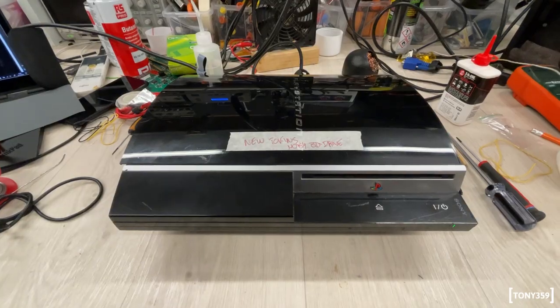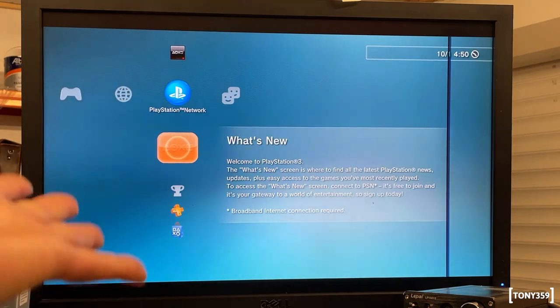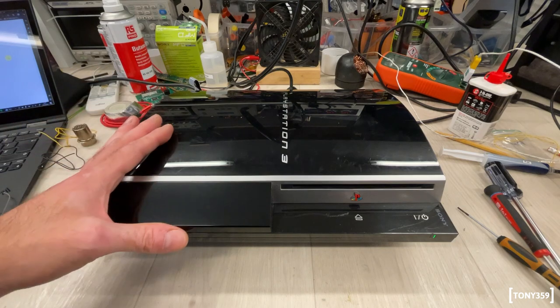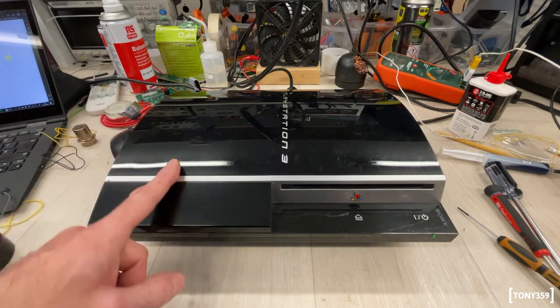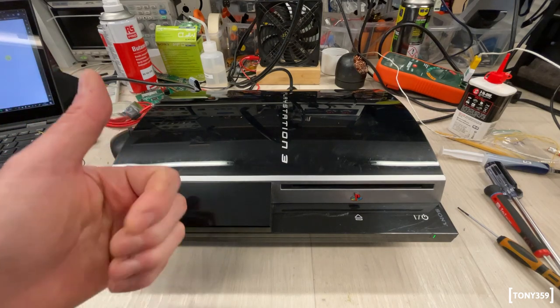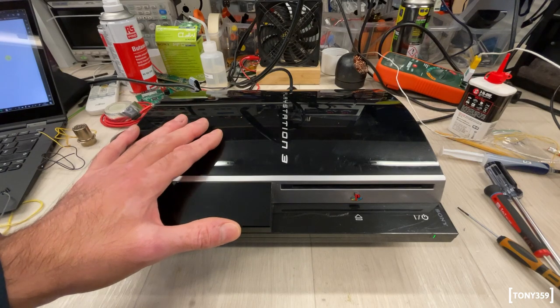Is it doing something? Yes — yes! This is working! Fantastic. This is my first successful deliding of both GPU and CPU. It's working. I'll take it inside and play some games. I tested this PlayStation last night, played some games — no issues whatsoever. It powers up totally fine, works totally fine. It's a bit on the warm side, but that's normal for fat PlayStations. From my point of view this is totally fixed. It would need some tweaks — thermal pads and such — but I'll leave that to someone else, you'll find out at the end of the video. This is a successful repair. I would say it's my first actually repaired PlayStation — definitely my first successfully delided PlayStation. And I feel pretty happy with that. Remember this one still has the noisy Blu-ray player; nothing I can really do with that — it will need a replacement motor assembly or whole Blu-ray unit.